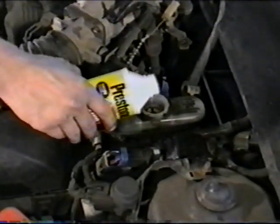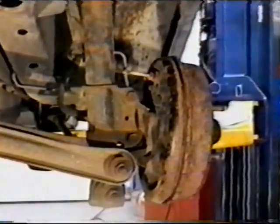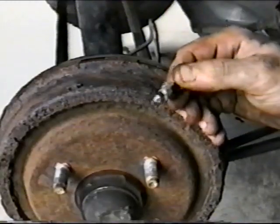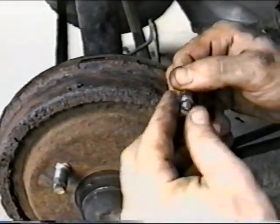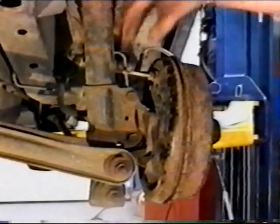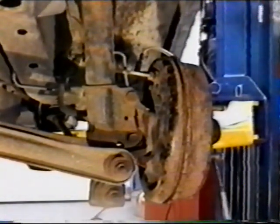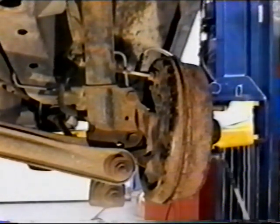Raise the vehicle to a suitable work height. Starting with the first wheel in the bleed sequence, open the bleeder screw. If the bleeder screw is loose fitting, then remove it and apply a film of silicone lubricant to the threads. Attach the vacuum side of the tool to the bleeder using the appropriate adapter. Attach the output end of the tool to an empty capture container.